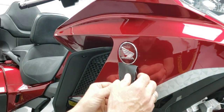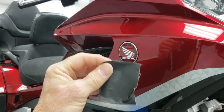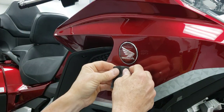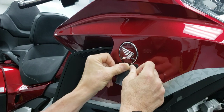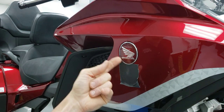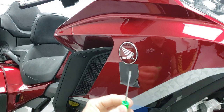The first step is you want some heavy tape like duct tape, or this gaffer's tape I'm a big fan of. Paint tape is okay but it's kind of thin. You want something because we're going to push on this a little bit with a screwdriver. You're going to tuck up under the groove — you can actually feel a groove with your fingernail. Try and force it in there and just come up at it from six o'clock.